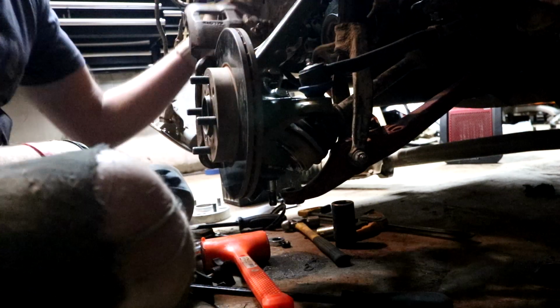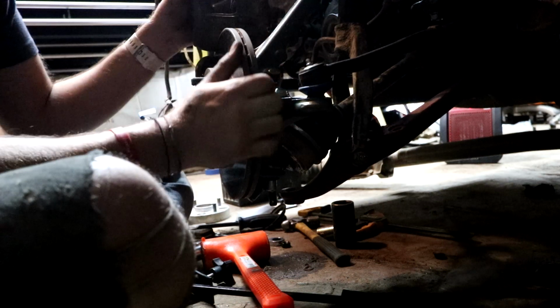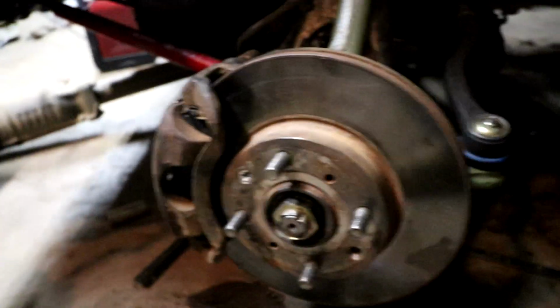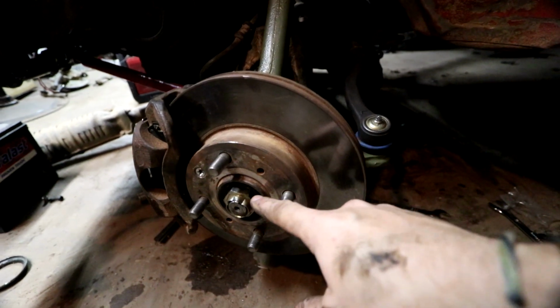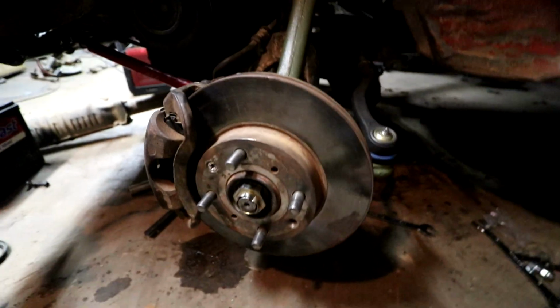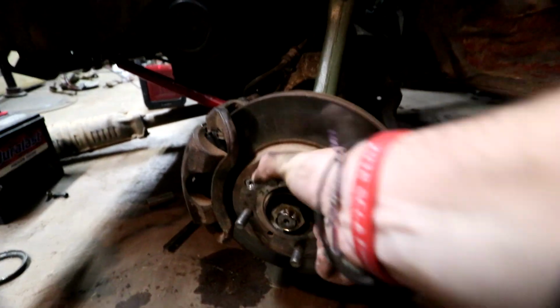So I'm going to put this brake caliper back together and bolt it back up and make sure we're getting free. Alrighty, everything's torqued back down. Got the axle nut down, calipers bolted back on, the pads are back in, the castle nut on the ball joints on. Everything's good and tight, and now we have movement.